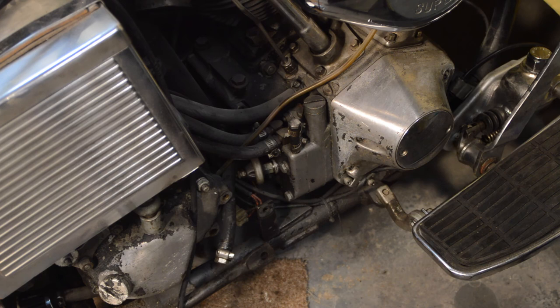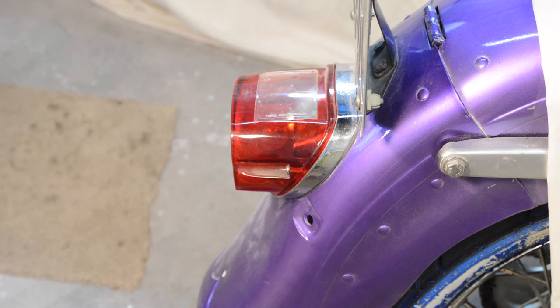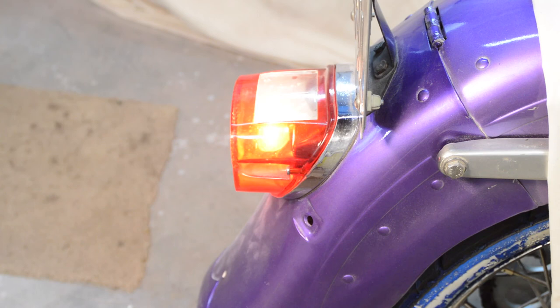Hopefully that's the brakes sorted — we've got front and rear brakes. I just need to sort out that wiring. If all the electrics work, lights work, petrol tank's painted, I think we just need to start refitting things like the exhaust and get this thing on the road. Final checks will be: screen filter, gearbox oil level, engine oil — get it hot then change the engine oil. Found the rear brake light electrical connection — ignition on — there we go, rear brake light, excellent. That's the back brake done, everything working.